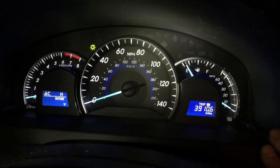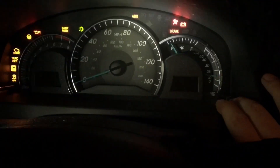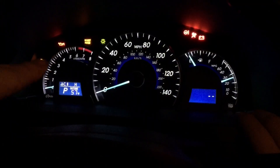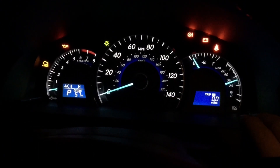There's off, accessory, and on. We're going to hold this button down and then turn that to the on position. And you see how those blink and that maintenance light comes off. So once it starts blinking zeros, that light turns off.